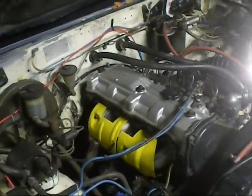Yeah, let's see what happens. Always try these tests in fourth gear, or whatever you can manage, just in case the engine goes runaway on you. You just dump the clutch. Probably too retarded now, but it sounds heaps better. Put the pipe on, better. Valve with it off. Still wobbly though. Still very smoky too.